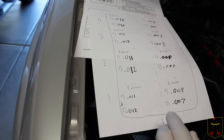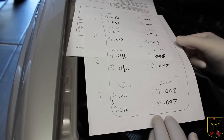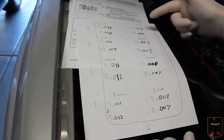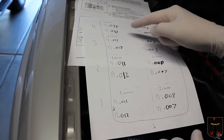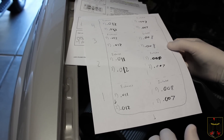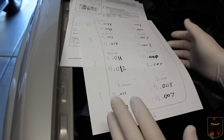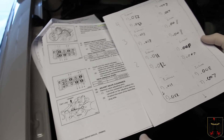Some great news — everything is actually well within spec. We made all the checks and intake should be between 0.006 and 0.010; they're almost right in the middle of that. Exhaust should be between 0.010 and 0.014, and they're pretty much right in the center of spec — certainly not too tight. I've read on forums that people are having problems with the valves hammering their way into the seats and becoming too tight, but we don't see that here at all. I think that speaks volumes for changing the oil every two to three thousand miles, and I also use ASL cam guard in my engines.